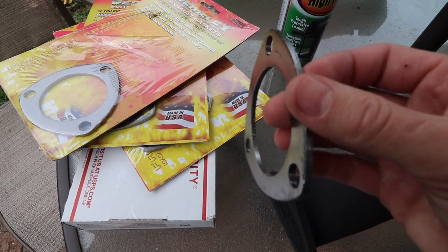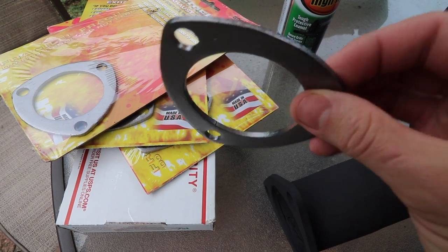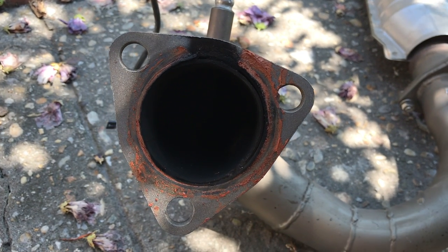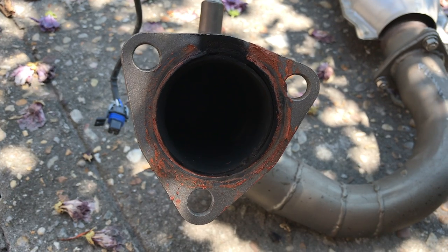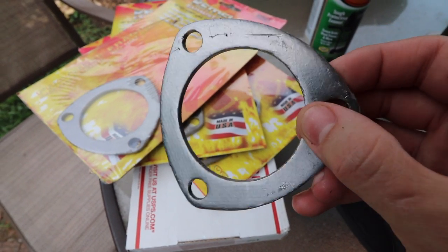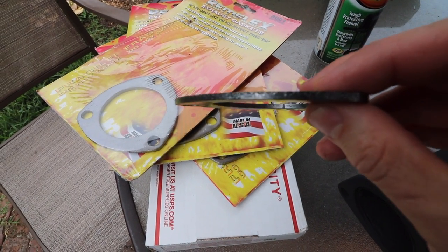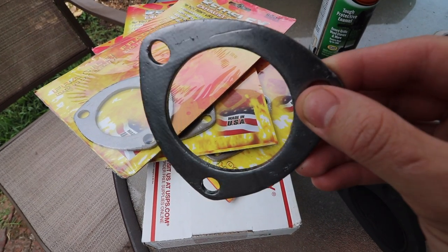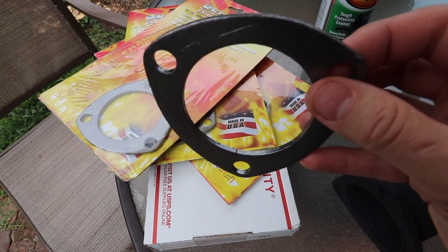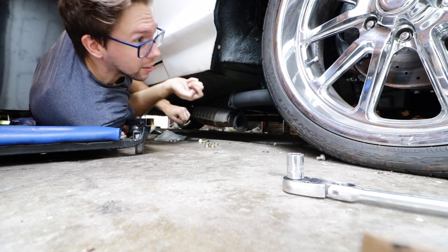These guys are made by Remflex. They're super soft — a fingernail drag gives it a dent. The idea behind them is they can seal the most horrifying things you've ever created. You can see the black soot where the blowout had been happening for quite a while, and it's making me reevaluate if gluing them on there is really a good plan. Since they're made with graphite and they're so soft, when you're torquing these things down you actually have to be careful — if you bolt them down as hard as you possibly can, you could squish them out of the header. They only want you to torque them to like 20 foot-pounds. I've never met the person who could get a torque wrench to actually fit in their engine bay, but 20 foot-pounds ain't much. So I don't actually use a torque wrench — I kind of just visualize it and give her an ugga-dugga until it feels good.